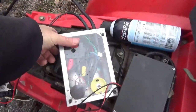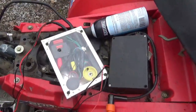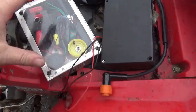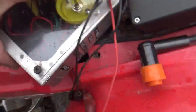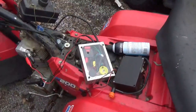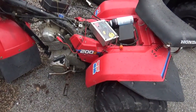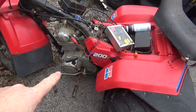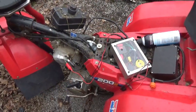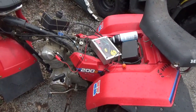You can see the leads are much, much longer, right through a grommet so they don't get pulled out. The spark lead is longer. I went with a 12-volt battery from the Warrior — clear cover. You can see the 12.1? That's telling you how much voltage is on the lithium ion battery, so you don't stand out here and pull the string until you fall over. This thing wouldn't start, so I put my portable CDI unit on it and three pulls later it was running.